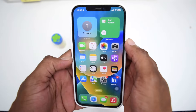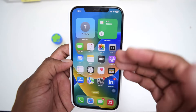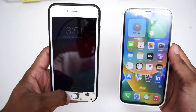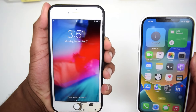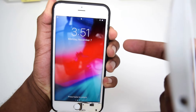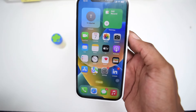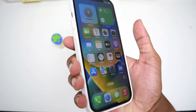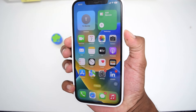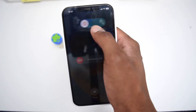If the speakers don't sound better after the hard restart, we'll move on to the speaker cleaning method where we clean both speakers. Before cleaning, you need to turn off your iPhone. For any iPhone up to iPhone 8, simply press and hold the power button and then slide to power it off. If you have an iPhone X, 11, 12, 13, or 14, press and hold the power button along with the volume down button, then release them once you see the 'slide to power off' option, and slide to turn your iPhone off.